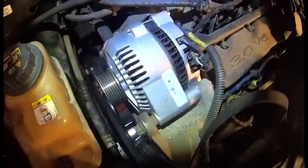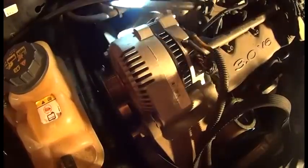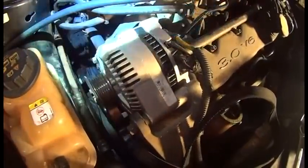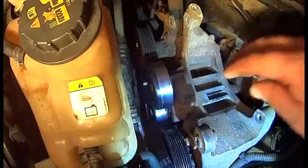After that, you want to take your alternator off. I think there's about four bolts. Take this bracket off here — it's not too bad. Unplug your little plugs and leave the hot wire plugged in. You can set your alternator to the side.